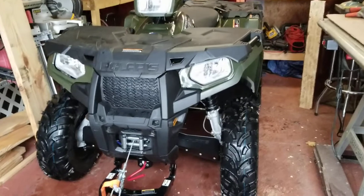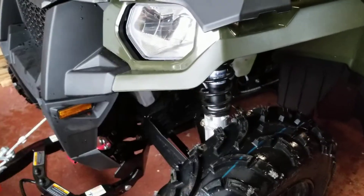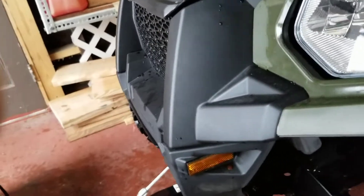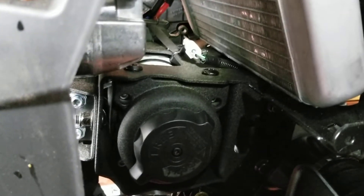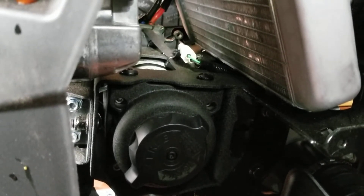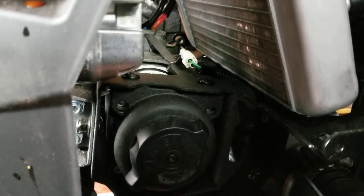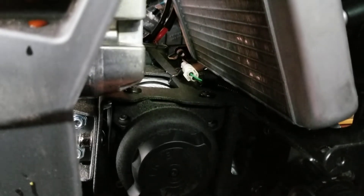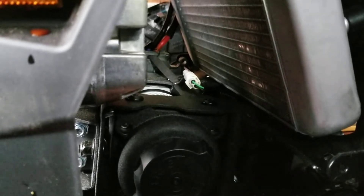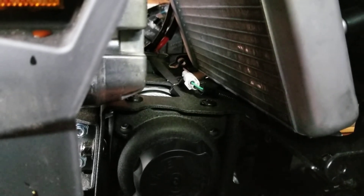It was just loosely together — they clicked it but it didn't work. I couldn't believe it. Let me get the trusty flashlight. With the vehicle running — you see that switch right there with the green wire? That's the switch for the winch. That wasn't pushed in all the way. When they installed it, they just forgot to push it in all the way. He said it could have vibrated loose. So that's what I'm going to be checking from now on — there it is, guys, that was the culprit.